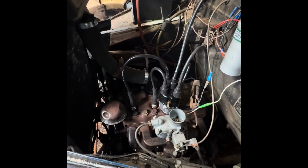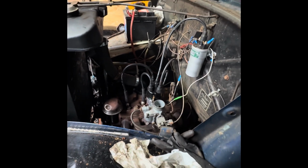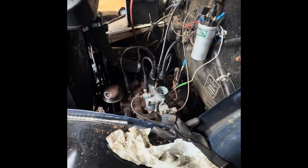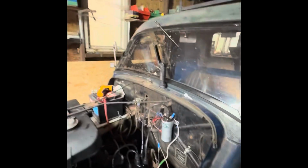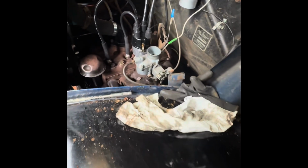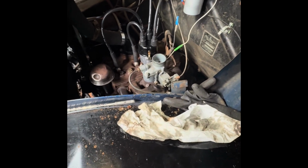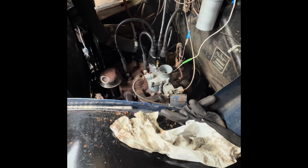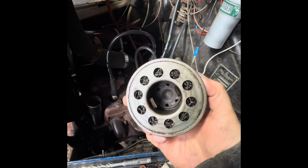But yeah, at the moment not seeing anything engine wise suggesting that it's burning coolant. I think the likely scenario is that whilst flushing the block, I mean, as you can see, we've had water everywhere, and I think a decent amount probably went down the distributor drive, which is just an open hole to the crankcase, so it probably doesn't take very much water to mix in with oil to make it go mank. But so far, so good. I think we're okay, hopefully.